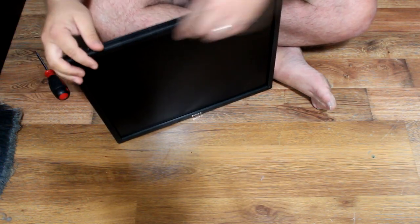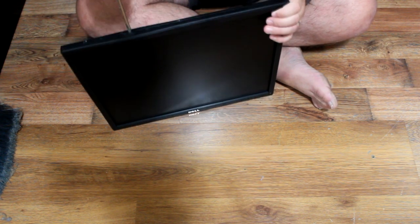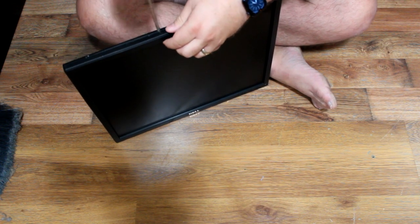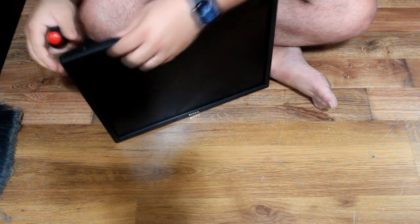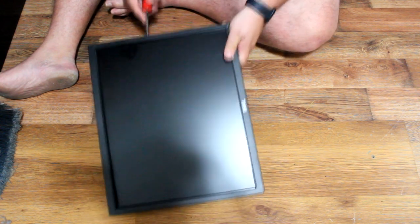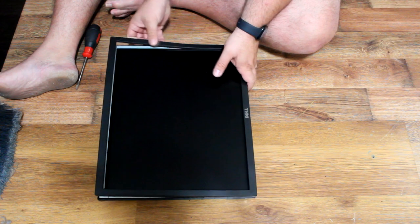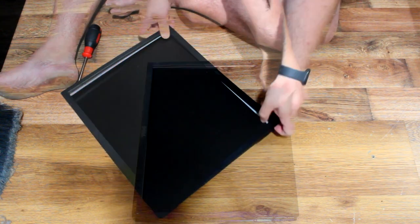The first thing you're going to have to do is decase the monitor. I'm going to be honest — this is the first time I've ever decased a monitor, so I was a little nervous. Fox used a bunch of tools, but I found the easiest thing was to take a flathead screwdriver, stick it in to find the links, and crack those apart without damaging the screen. Then once you get it going, it's relatively easy — it's just finding the points where the monitor connects. Open it up like a book because there are cords connected inside.